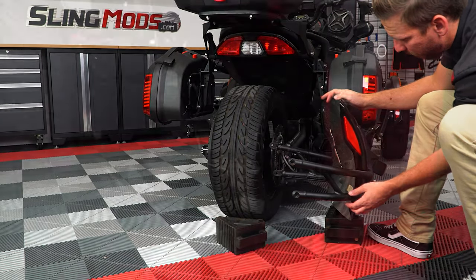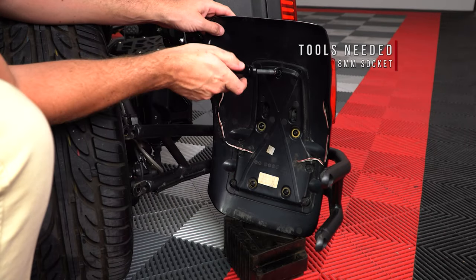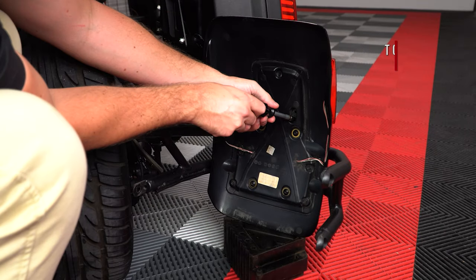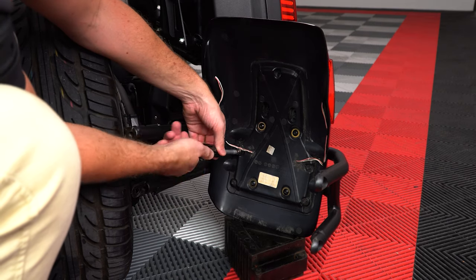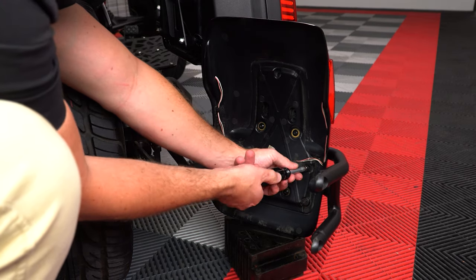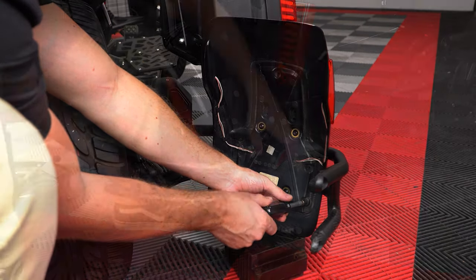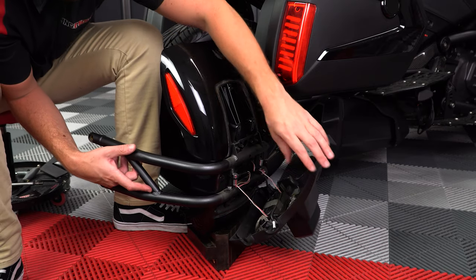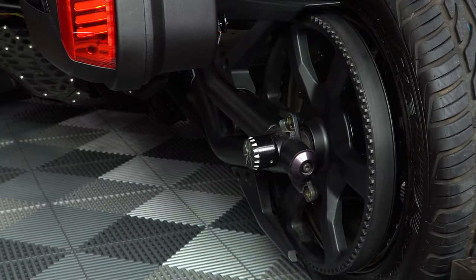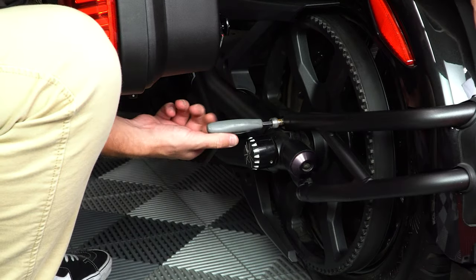so that you can unscrew these 7 8mm screws holding the outer plastic license plate cover on. Once that's out of the way, you can now lean the fender up against the tire, adding one of the Allen screws to hold it in place.